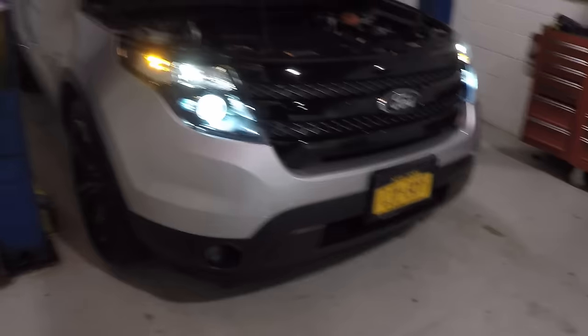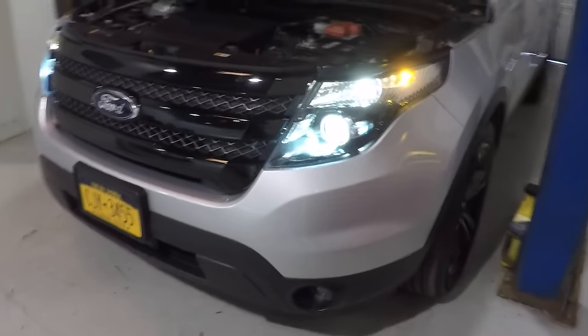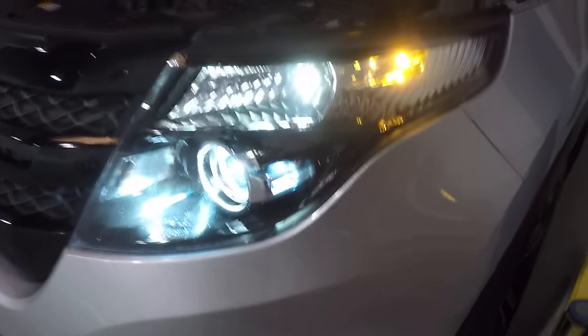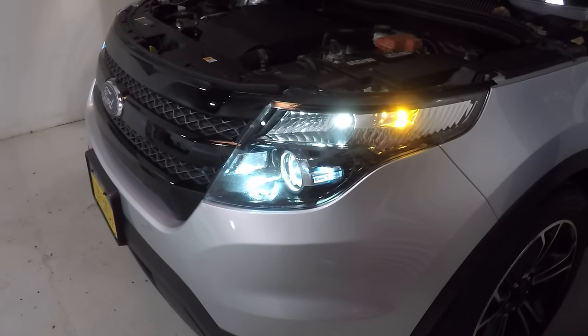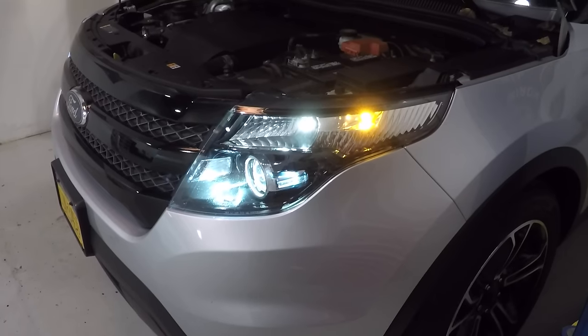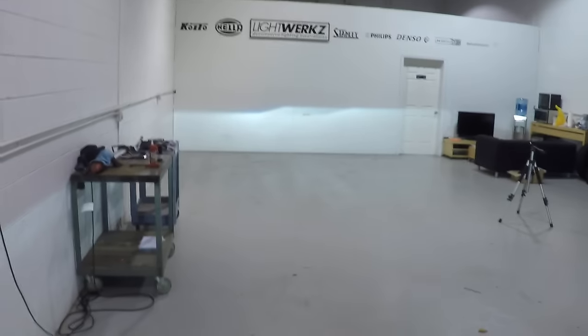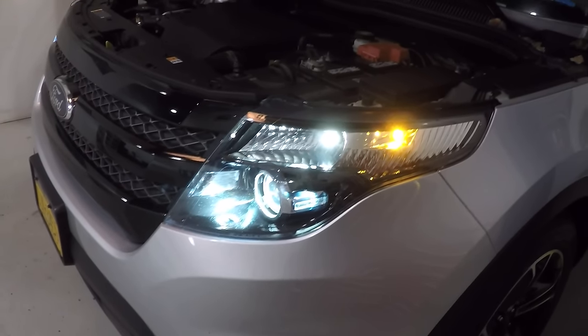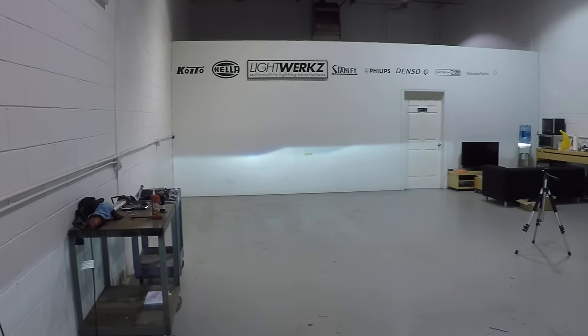If at night you want to go out and give it a test run and raise it a little bit higher, you can do that — but bring it down if you see that you're annoying people. The light should be floating around the license plate area of the car ahead, never in the side view mirrors, and absolutely never in the center rear view mirror inside the cabin — that's way too high. You want your lights gradually falling down at a distance, which is exactly why we set it 2 inches lower than the center of the beam. That means it has a gradual decrease as you're driving, and eventually it's going to hit the horizon.